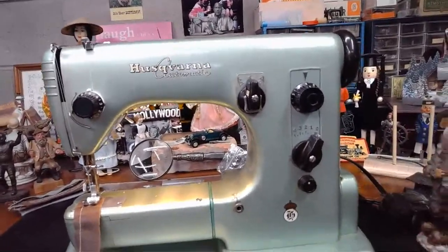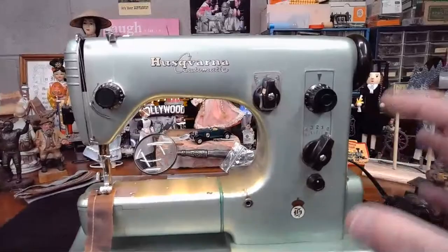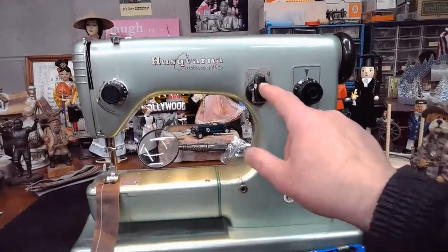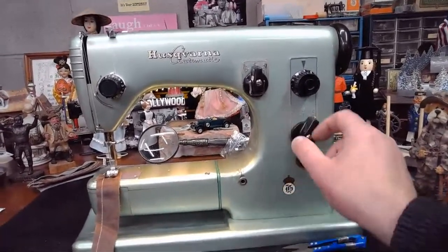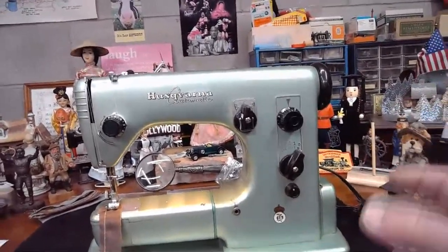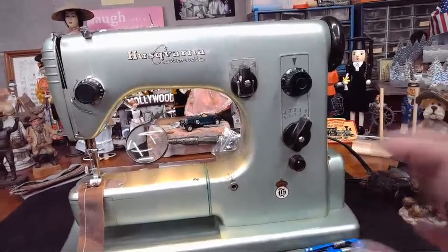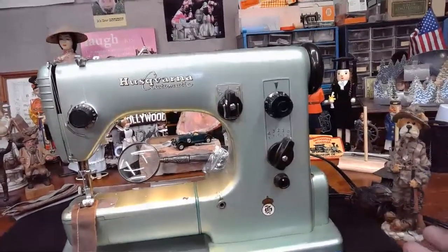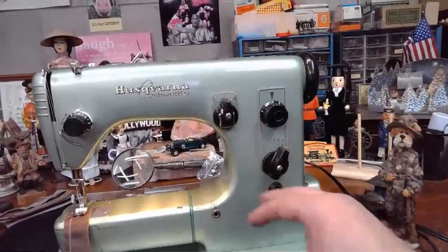And not necessarily because the sewing vac people were trying to be deceptive, although I suspect they were, but because they didn't have the simple knowledge of knowing that the needle position on these Swedish Beauties is only going to work when you're set to do a straight stitch, not when you're set to do something that requires needle swing. Okay, so again, the power of the classroom is we learn together. Some of you or others that watch this live stream later on are not going to know that, and they can avoid an expensive service call to a sewing vac or a sewing center and paying someone to fix what already is engineered to do what it's doing in the machine.